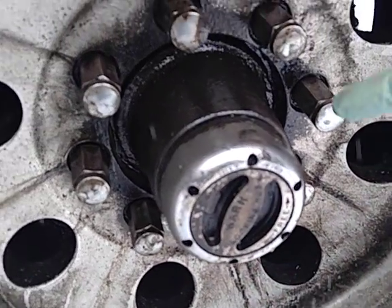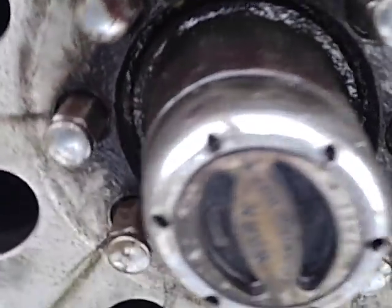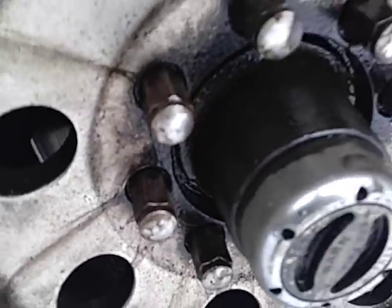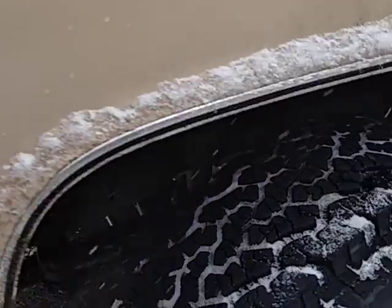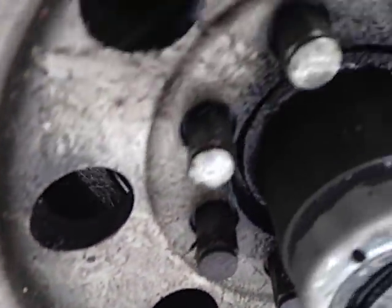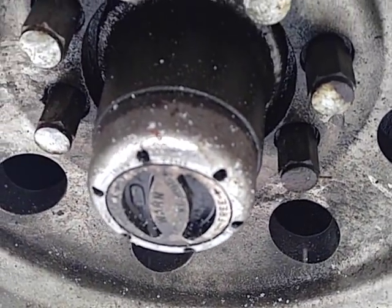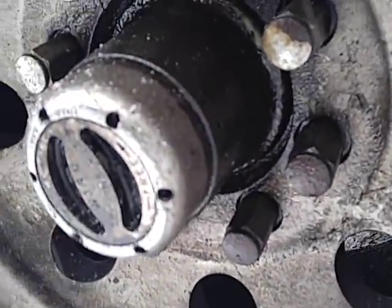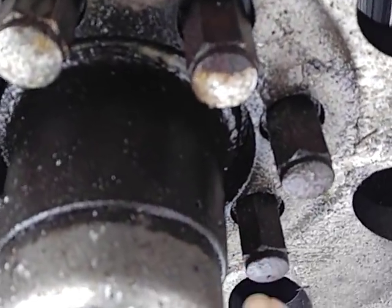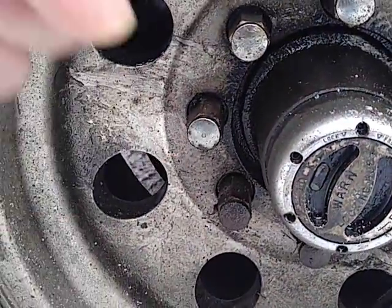It's a lot of work to get these on or off. You've got to undo a snap ring that you can't undo. So I drilled a hole — I drilled a hole in my hub so that I can release that c-clip. Because you try to grab it with a couple of screwdrivers and all you do is end up busting the screwdrivers and chasing the thing around. So I drilled a hole, right there. I measured very carefully and drilled a hole right under the c-clip so that I can lift up one edge of it and get it out of there. Do you think it's easy? It ain't easy.